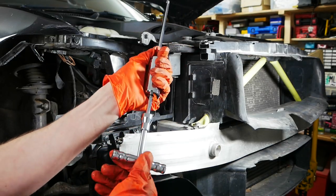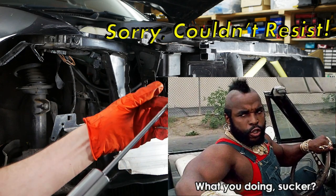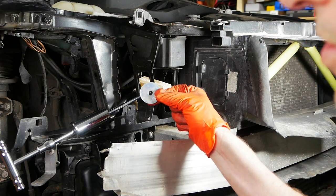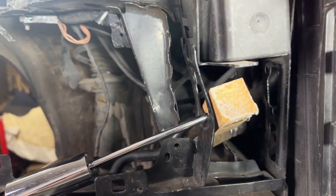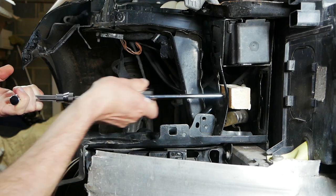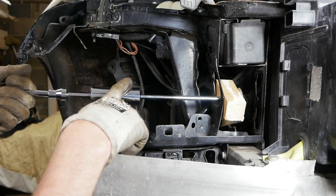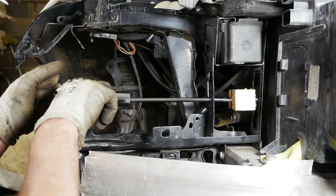What I have here is a lightweight slide hammer from a dent removal kit I bought off Amazon. Normally this end would just attach to some suckers and you'd pull the dent out with the hammer. I've got a block of wood with a hole drilled in it - I'm just going to stick it behind there, and then on the other side there's a penny washer and a nut that goes on the end of the shaft. It helps if with your left hand you're pulling in the direction you want that to go, so you've got some tension on it already, and then this weight is just adding to the force being applied. Obviously it'd be easier with a heavier duty slide hammer, but as you can see it's a lot straighter than it was.